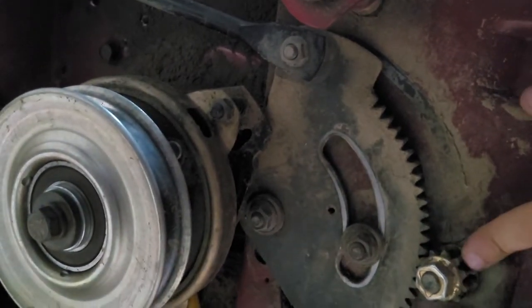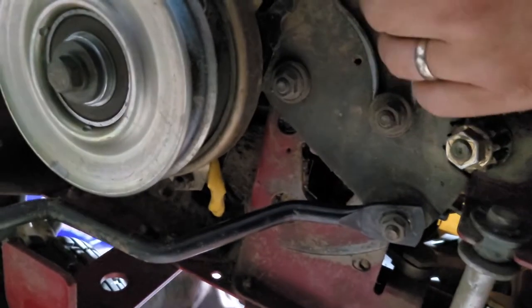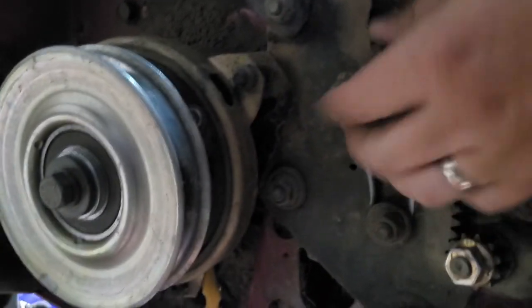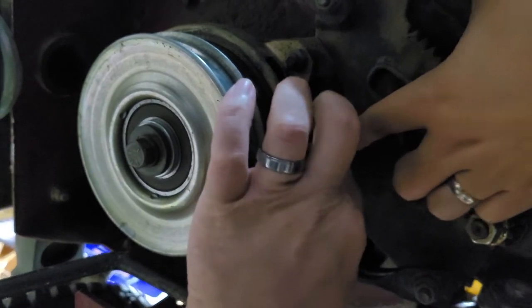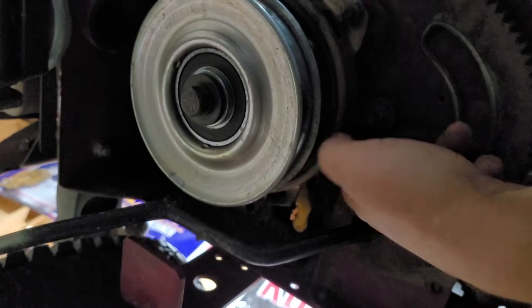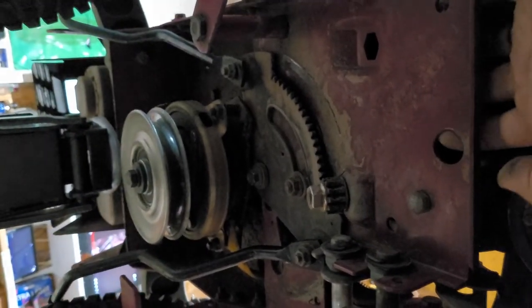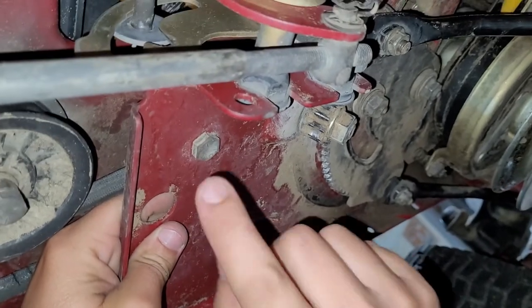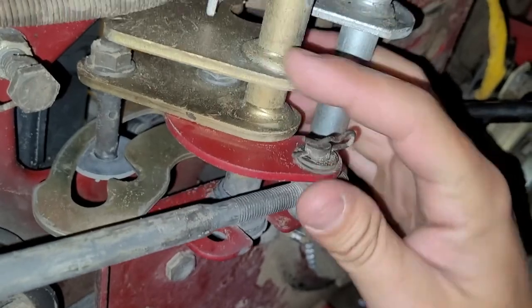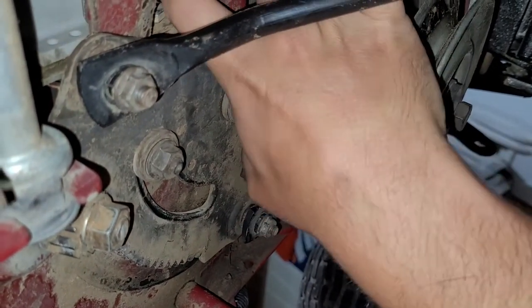This is that steering gear, and there's not really a lot of rock and roll in there, so that thing is not rocking as much as that is, right? So it's this plate, and there's not a ton of videos out there. Once this bolt comes off, there's a bushing right there, and on the top is where the nut is, and you've got to slide it straight up and out. Either you come up under this cross member that's here, and that's crazy. The cross member may have to come out, and that's what I'm really worried about, because when you take this out, all of your plate assembly and everything here comes out. I'm not 100% sure if we can get up and under there.